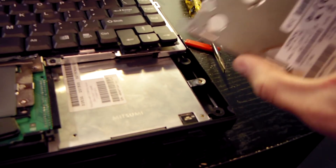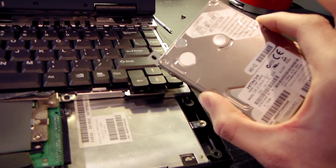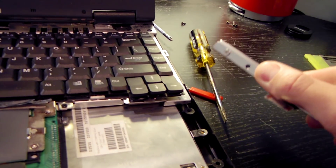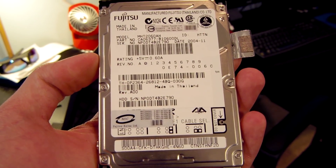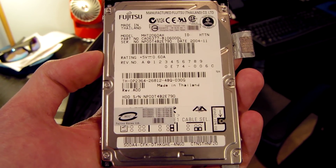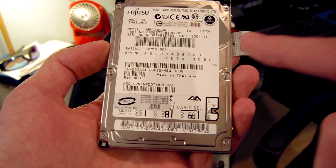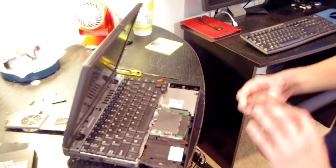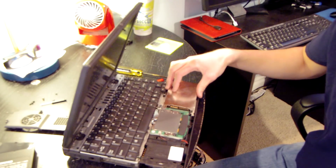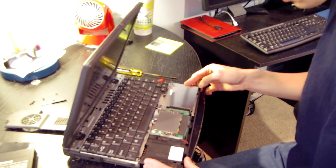Before reassembly, I want to replace the Hitachi hard drive. I'm going to pull it out of the drive bay and throw in a 20 gigabyte IDE hard drive from a Dell Inspiron I don't use. The replacement is a 20 gigabyte 5400 RPM Fujitsu drive manufactured in 2004 — I'm almost certain it's functional since I was just using it in a laptop I carried around in high school. As a placeholder, I put the dead Hitachi drive into the Dell Inspiron since the screws wouldn't go in without it.